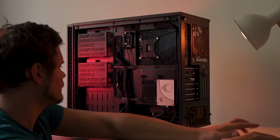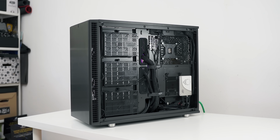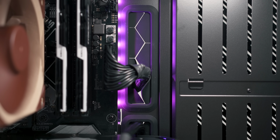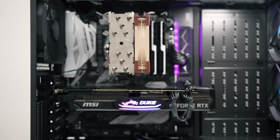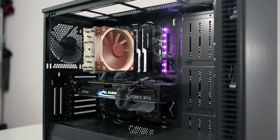And even though there's plenty of room beside the power supply, the back area is well designed to handle any of those exits, so they're not completely sticking out thanks to those Velcro straps. Now, the one thing I absolutely love on the interior in terms of cable management are the long rubber grommets, basically spanning the entire height of the motherboard. And they're not split into like 3 or 4 like on many other cases. This means that I can route my 24-pin in the exact location where my 24-pin cable is located on the motherboard, and that's been kind of frustrating with many other cases, but not here. Obviously, there's so much extra room beside the motherboard for reservoirs and radiators, but that's not exactly what I'm going for here.